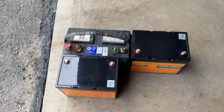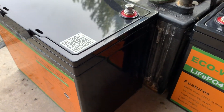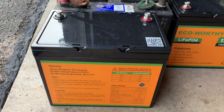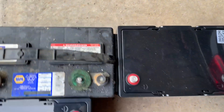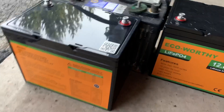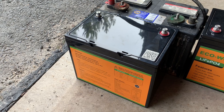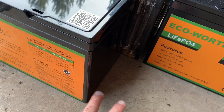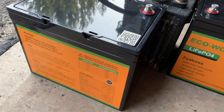In terms of dimensions, it's obviously shorter lengthwise, which shouldn't be a problem — it's when the battery is too large that it's an issue. Same height, no issue there, same width, good, and just a little bit shorter on length. I'll make sure I get some replacement tie-downs, because those will be what's keeping this battery from moving. I'll probably also stick a piece of wood in to jam it so you don't get back-and-forth movement once it's in the tray.